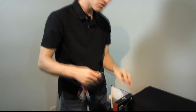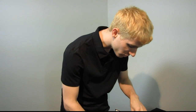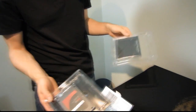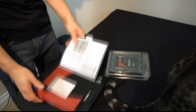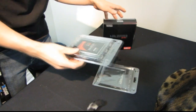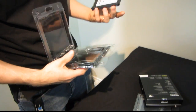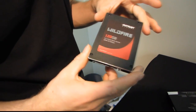It's funny that they don't include any performance metrics on the packaging, because really that's what the Wildfire is all about. This is a second-generation SandForce controller-based drive — the SF-2281 controller — and it uses toggle NAND chips. That's why it can achieve higher IOPS — 4K IOPS, or I/Os per second — which means that in a desktop or even a server workload, this drive will perform as fast as anything else in the market for a single SATA 3 6 Gb/s drive.